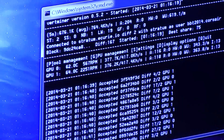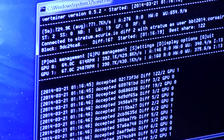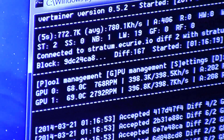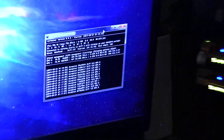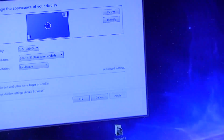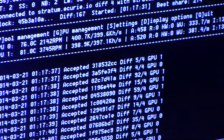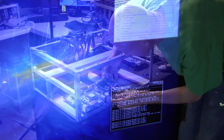The real interesting point about this coin is the adaptive Scrypt — the hashing power is roughly half compared to standard Scrypt. If you have a 4.8 megahash rig, you're getting about 2.2–2.4 on Vertcoin. Here's a quick visual: two Sapphire Toxic R9 280Xs, which hash over 800 kilohash normally, drop right to around 400 kilohash on Vertcoin. Post your Vertcoin configs below. We're currently working through a thread concurrency wall at 8192 — once resolved, we'll post that.